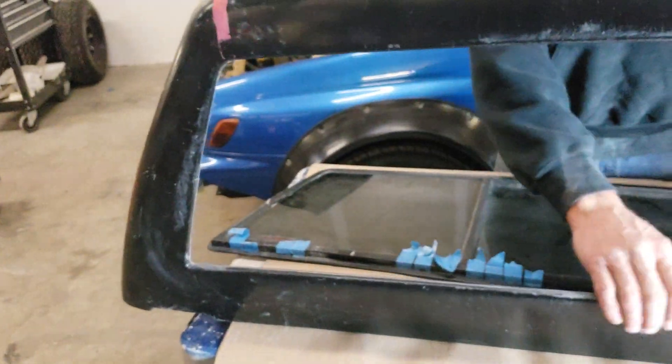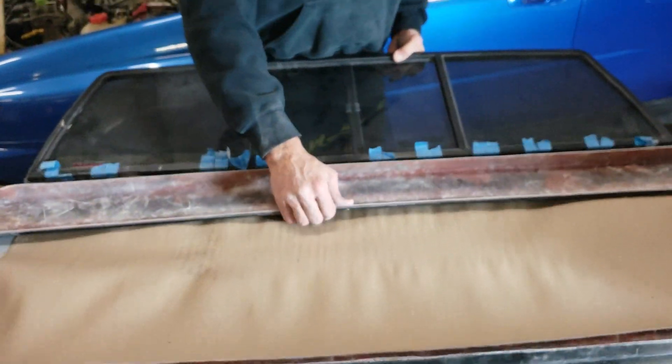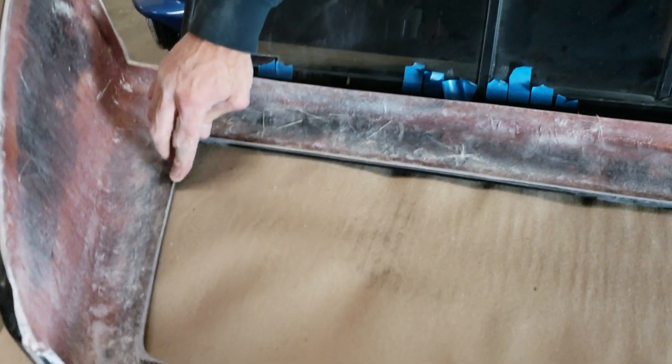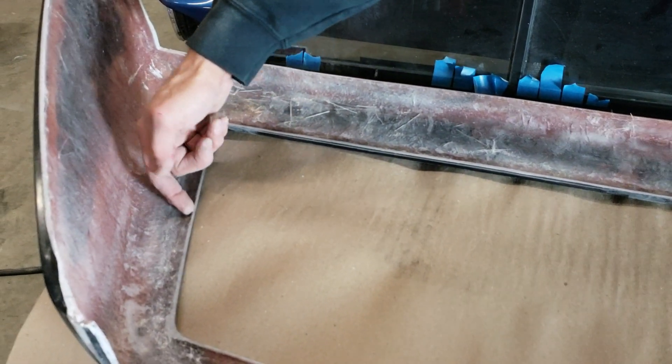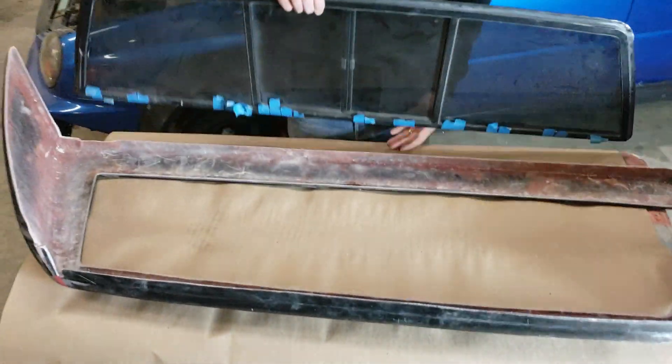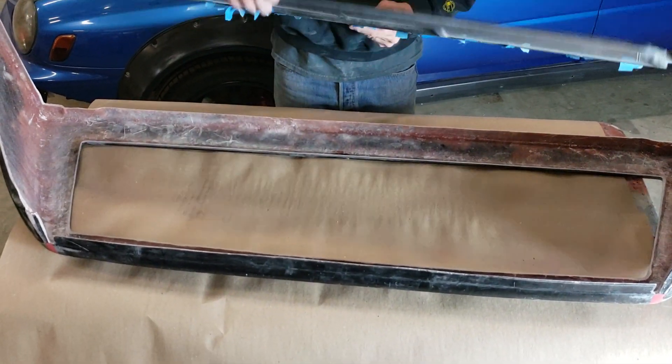Get your rear surround. I'll flip it upside down so you can see the raw fiberglass inside that we're going to bond the window to. So come on in here, take a look. This is the raw, ugly inside of the fiberglass that you would probably be painting with a bed liner or covering with black carpet in the final car — that's up to you. You can see here our 3/8 of an inch flange and you can see how it's sticking up here. We're going to be taking this window and placing the window into this opening from the inside of the car.